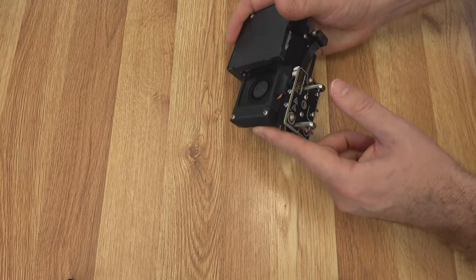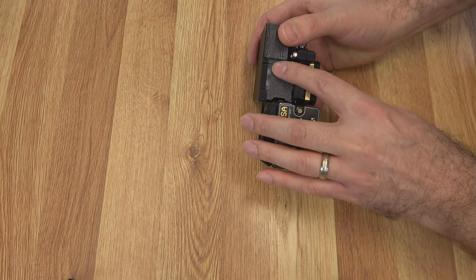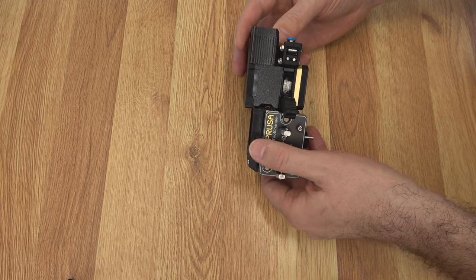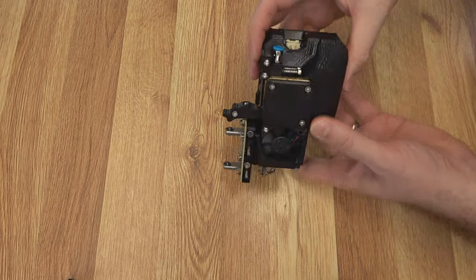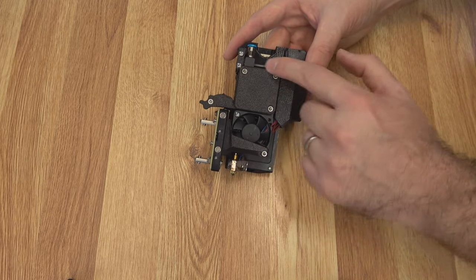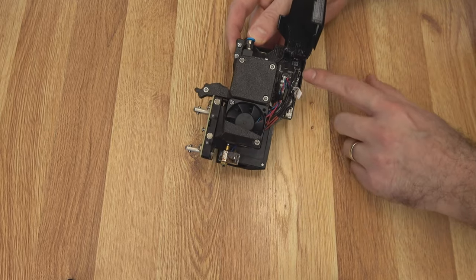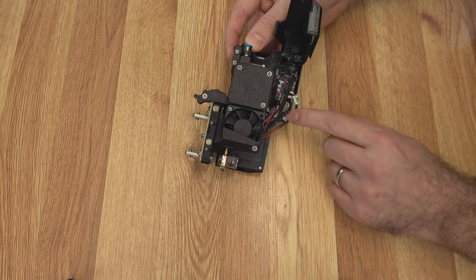Your part fan is over here and your duct. This is a set of buttons with a status light telling you the status of the tool — you can actually unload and load an extruder with these buttons. You have your idler door right here; you can see the extruder gear and how it pulls filament in. Back here is a PCB that allows you to plug everything in and connect a cable on top to the machine. The biggest thing you need to be concerned with are the gears inside — it is a planetary setup and they need to be aligned and calibrated correctly.